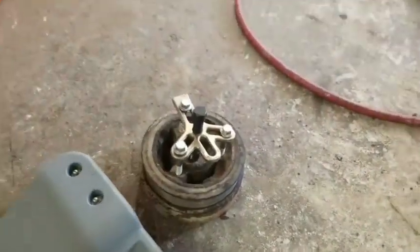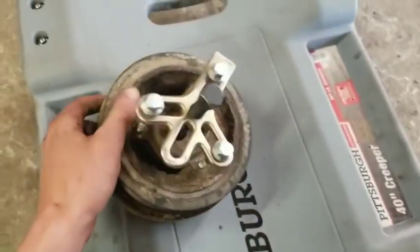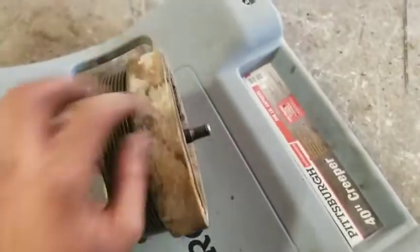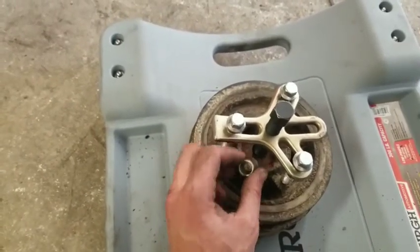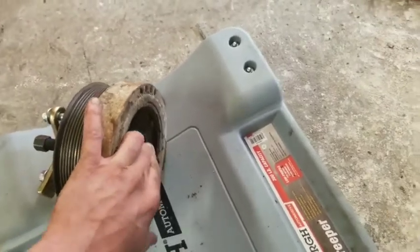In order to get this harmonic balancer off, get a puller like this. There's a Woodruff key on the shaft to make sure it stays put. The puller has to be designed to go through that part — it's pretty narrow. This particular set has an extension piece that goes in here. You've got to get the extension to go through the inside where the threads are in the shaft and go right through the crankshaft with it. So there is the low pressure oil pump right there.